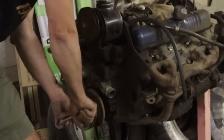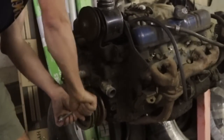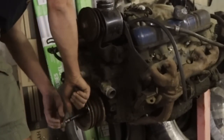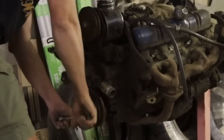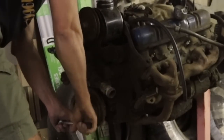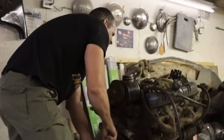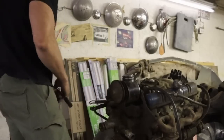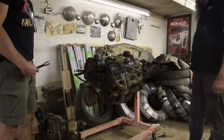Oh yeah. It's fun. Oh, that is exciting. Sweet. Do you hear any rods clanking? Oh, back up. There's no need. We don't want to break a ring. I was hoping it was full compression. Did it back up? It's hitting something though. That's not right. Yeah, we'll pull the head. It could just be a stuck valve. There's no point wiping out the cam. Sure. That's fine. I don't care.